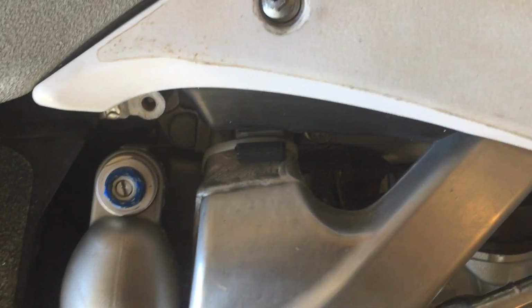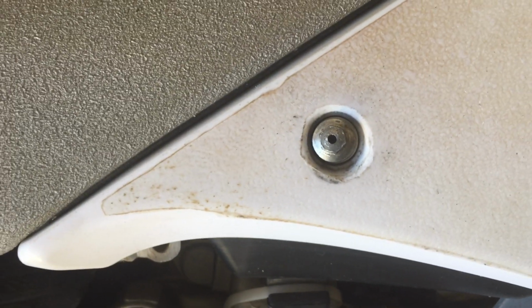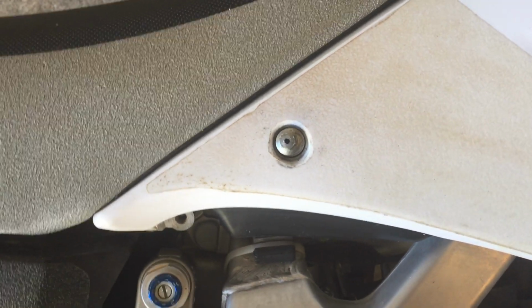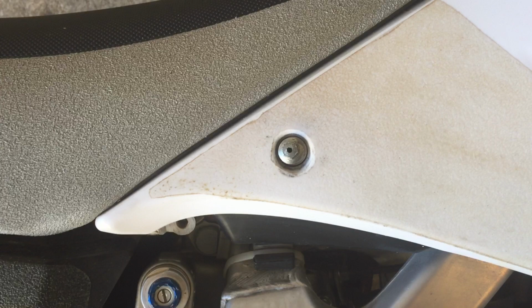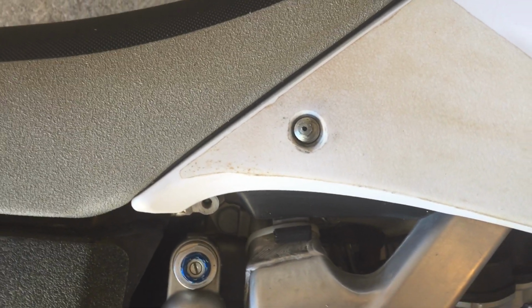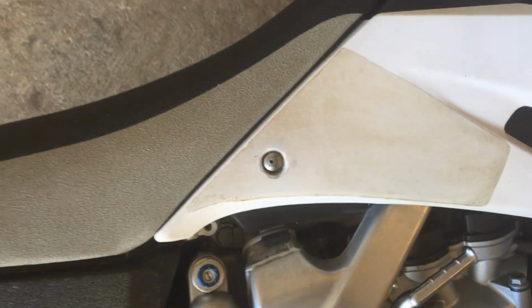So anyway, got myself access to the back of the bolt because the way I figure, if you're trying to fill this divot up with penetrating oil or something, probably more of it is going to end up in the space between the threaded insert and the gas tank than the threads, which is just going to lubricate that and make it more likely that that insert strips.